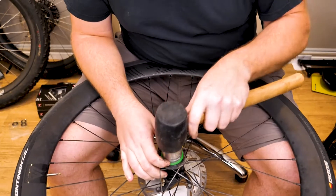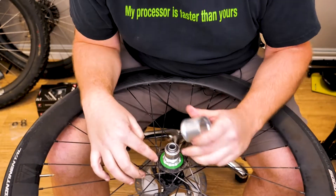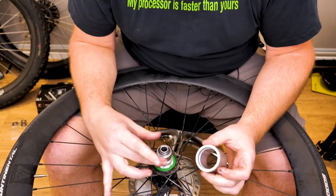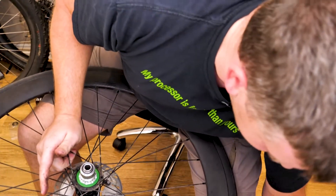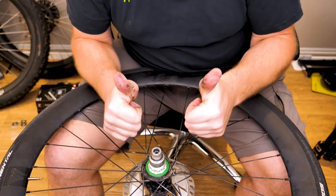You can do it with a blunt object — let's go to town. Make sure it spins nice and smoothly, because I've actually had it where the ring wasn't quite all the way into the freehub body after all this. Put that in, take your axle end cap, slide that on and you're good to go. There are a bunch of different sizes — I actually use one road cassette which is the 10-33, and the gravel slash wide cassette which is the 10-36, depending on my road wheels or my gravel wheels.